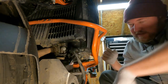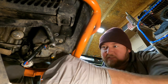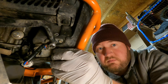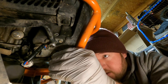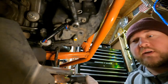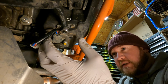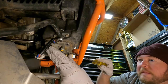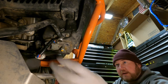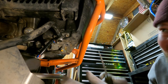They're a bit of a hassle. Now we can get the housing out. This is a T30. This shouldn't pop out on you — there should be a gasket in between there, and if it's never been off, it's not going to come out. I'm just going to take these all the way out. Most likely we'll need a flathead to separate the housing from the tank. You can kind of see how the skid plate here is interfering a bit. You should be able to slide it out and off to the side. I'm just going to stick a flathead in between the housing and the fuel tank and go around with it.